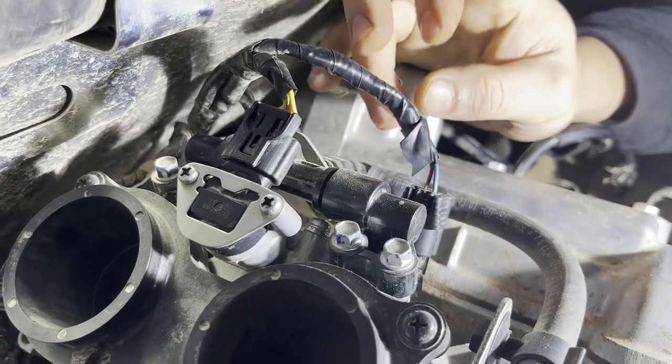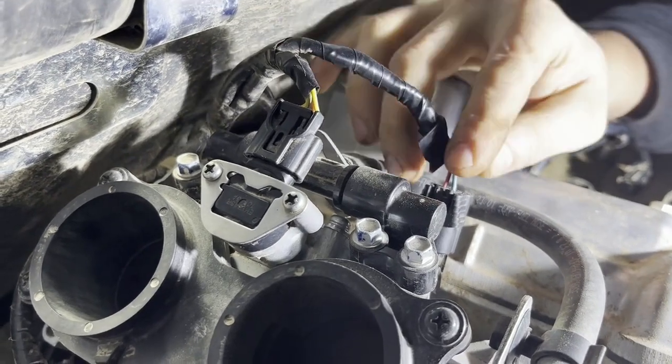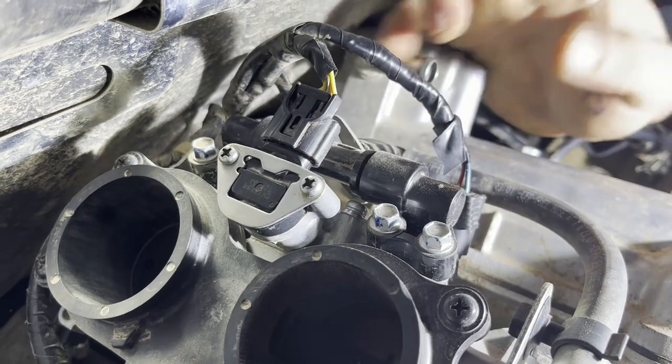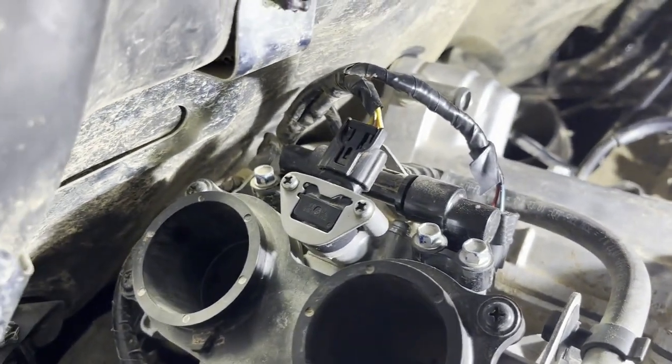I found a break in one. I spliced it back and seen inside it the wires had just broke. I soldered a new piece in and everything — fixed the problem. Things are running like it did when it came from the factory.